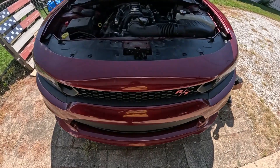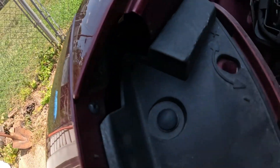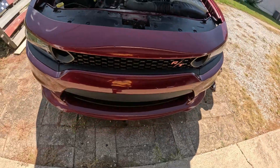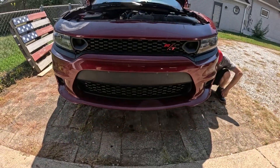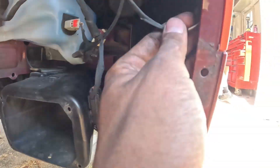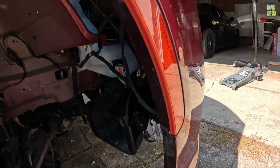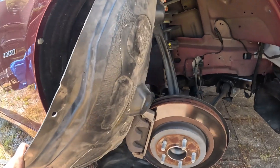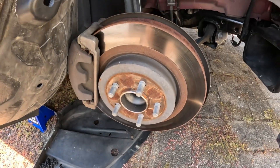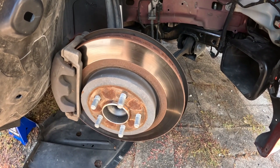Got that almost done — put all the plastic in, did all six bolts for the bumper: one up here, two on the bottom, one up here, two on the bottom. That looks insane. We just plug the lights back in, plug the fog lights in, plug the side marker lights in and the bumper is done. All we got to do is put this plastic back, put all the plastic pins back in, put the bottom on, and put the wheels on in reverse order.